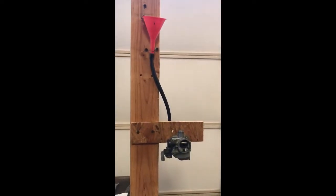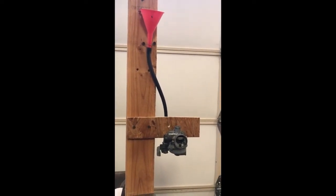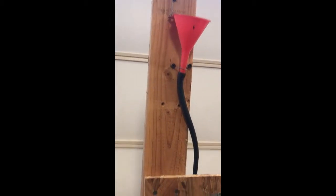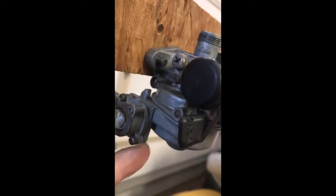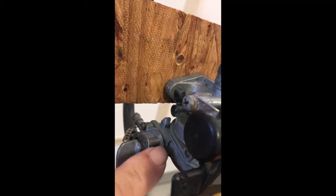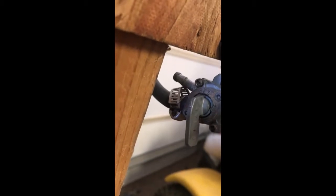I'm going to try to find out the leak now. I have a carburetor for that ATC 70 hooked up here and I'll use that for a gas tank. I have some clean paper towels and some gasoline. I'll probably be looking where the carburetor bowl connects to the carburetor base and also where the petcock valve assembly attaches. It could also leak where the hose hooks up — I'm not sure how good these clamps are when the diameter gets that small.